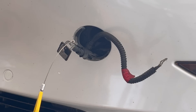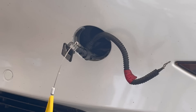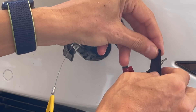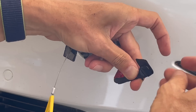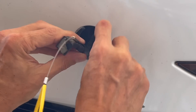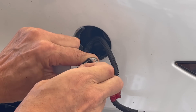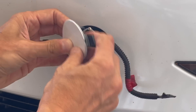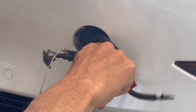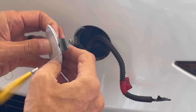Now that we're all done and we want to tuck everything away, we need to tuck these cables in and then take this and put the cover back on. Before we do that, you want to make sure that the positive cable — that the metal part is not exposed. This is the same rule that applies to 12-volt batteries: you don't want the positive cable to touch anything metal in the car. Once we ensure that, we tuck this all back in. There's some two-sided tape that's gotten old and dirty — I'm going to put some more on there. It's typically attached to this so that when you pull it out, it all comes out conveniently and doesn't get lost inside. By being attached to it, it just makes it a bit easier. If your car is newer, it's going to be attached to this.